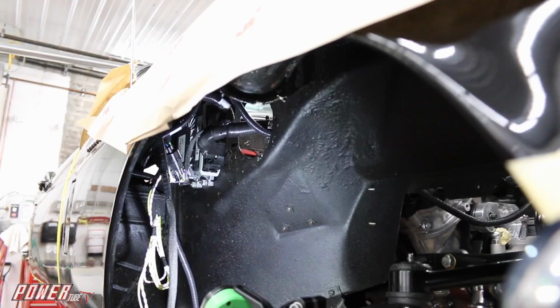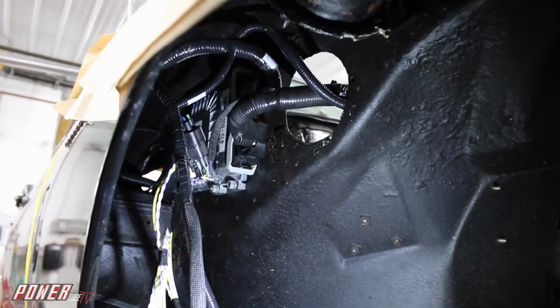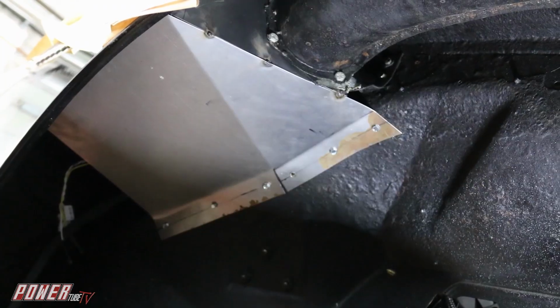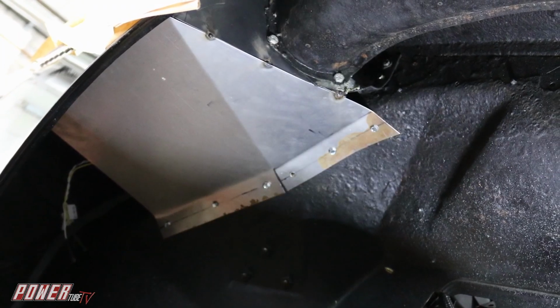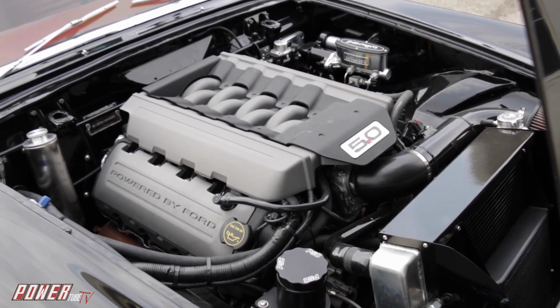So in this case, we didn't cut the Ford harness, and it did kind of lay in a certain place, but conveniently the original blower motor hole in the passenger fender landed right there. So we mounted the ECM inside the fender well and made a nice cover over the original blower motor hole. So that looks nice. And then all the other wiring and plumbing we try to run low and neatly tied up and clamped down, so you're not seeing hoses and wires all over the place.